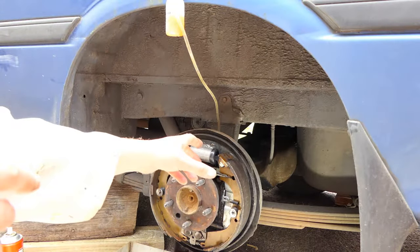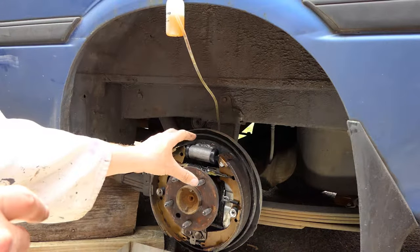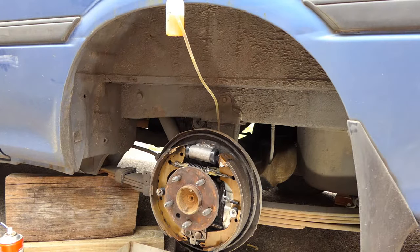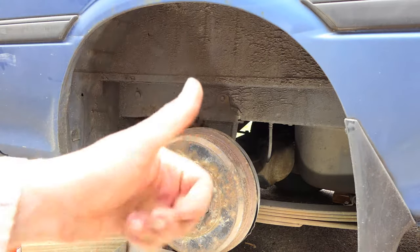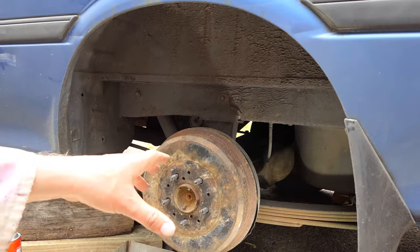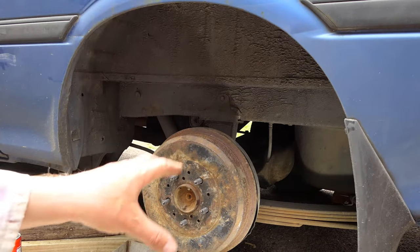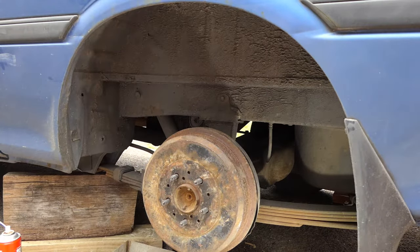Once I've done that, tighten up the bleeder valve on the back again, and then we'll put the drum back on, take it for a spin, and gently test these brakes. You've got to get this adjusted, set back where it was originally. Just check everything's not leaking, and then you're done. I hope that was of some help — if it was, please subscribe. Don't forget to check whether anything's leaking before you go for a drive. Take it for a test drive, pump the brakes carefully — it might feel a little different to usual. Just pump them a few times until everything feels right. Come back home, check that nothing's leaking again, and it should be all good. Thanks for watching guys, see you on another one.